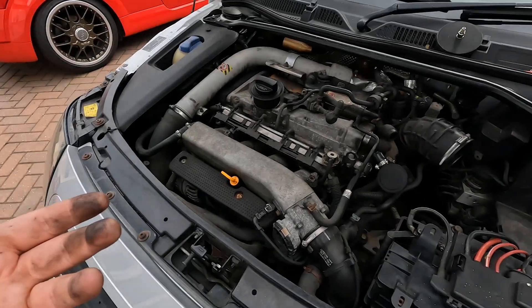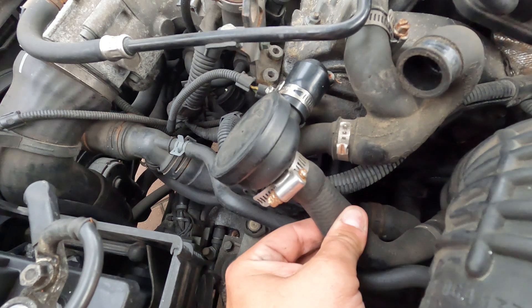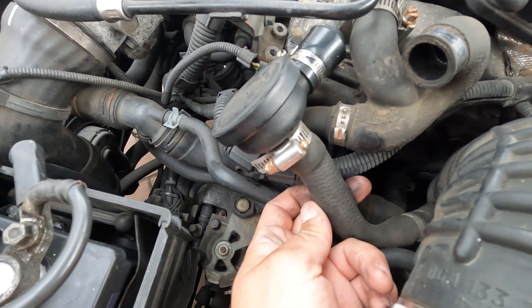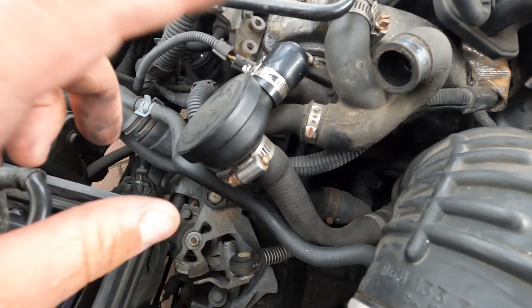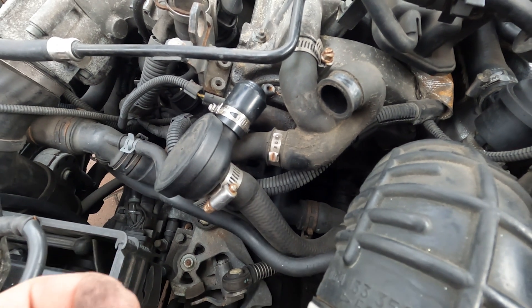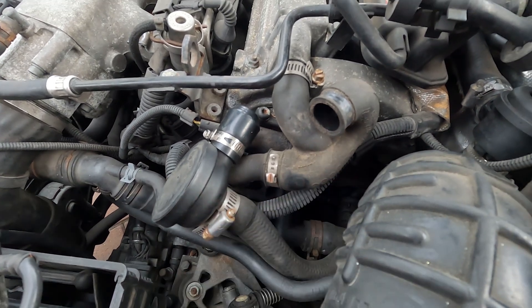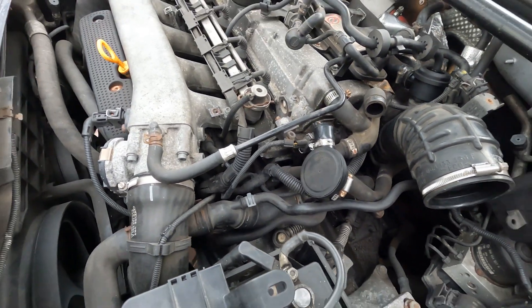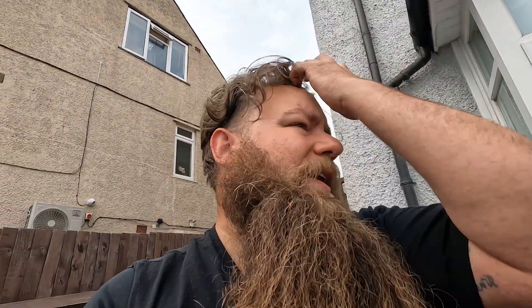Boost leaks and vacuum leaks are so common on these things — I mean, let's be honest, it's 20-something years old. This pipe here is a prime example — if you squeeze it, it should automatically come back and it doesn't, so it's definitely on its way out. You can reshape it and it pretty much stays there. This pipe could definitely do with replacing, and over another year or two it could fail and start to tear. These ones go all soft and perished because they get damaged by the oil. Things can also chafe, slip off, or fail in any number of ways.